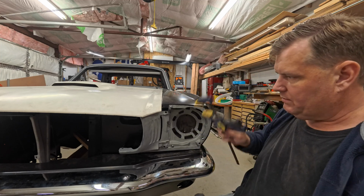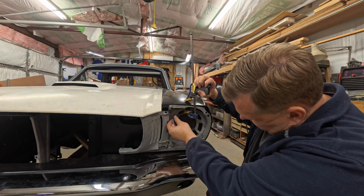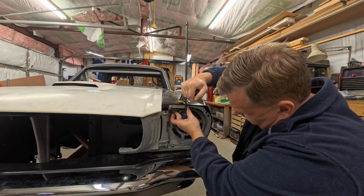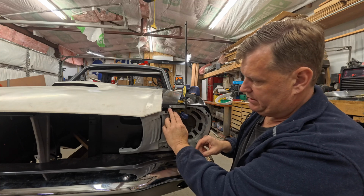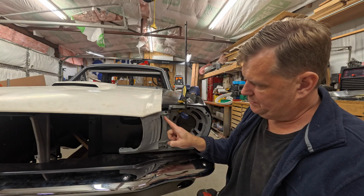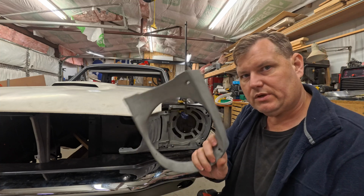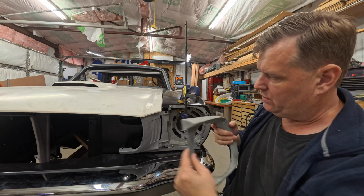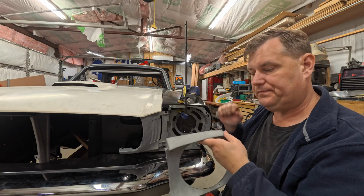Anyway, I'm going to get this clamp back up into place, and I will get that drilled. I'm probably going to put this right here first, because I pull that in there, and let's see if I can line this all up. Now, a big part of the reason that you need to pay attention to where this is, is because if this piece is sticking out, rolled out, what happens is this little pad is now rolled outwards. Well, if that pad is rolled outwards, that means when you go to put this piece on, you got this little round piece right back here that touches that.